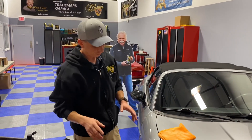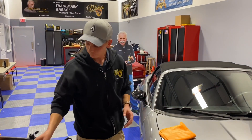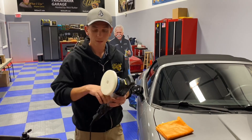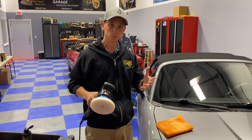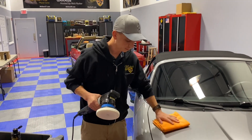I'm going to use the Fast Polish as my step before I wipe it down with the coating prep spray and apply our ceramic paint coating. If I did come across a scratch on the hood or the door, that's where this tool really excels — you can switch it over to rotary mode and have a direct drive tool that is far more powerful and more effective at removing scratches than a random orbital dual action machine.